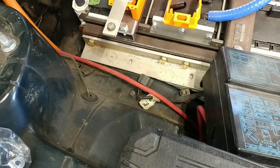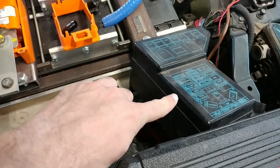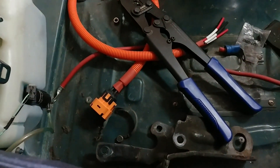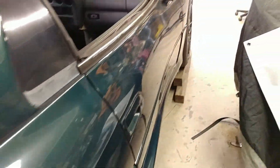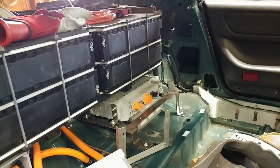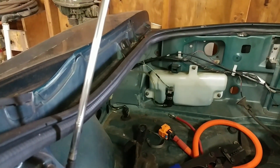You may have noticed the windows being down and a piece of red 4-gauge wire running around the car. This connects into the fuse box at the alternator 120-amp fuse, and runs all the way underneath the door — where some of the other interior wiring is — all the way to the back. The idea is to eventually mount the 12-volt battery there; you can see the ground strap we used to get the car powered up. The black round plug on the DC-DC converter is where the 12 volts comes out, so that'll have to run from there around into the back. I've also got a couple of resettable thermal fuses to make sure each line is protected.